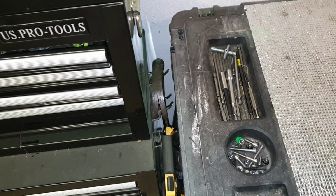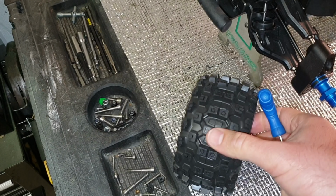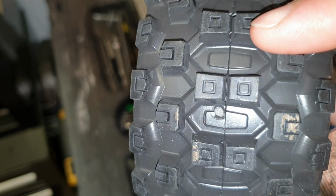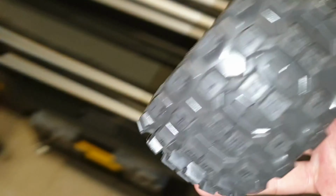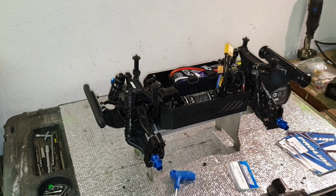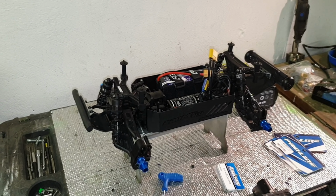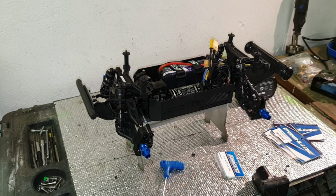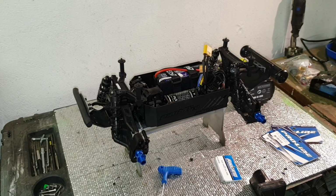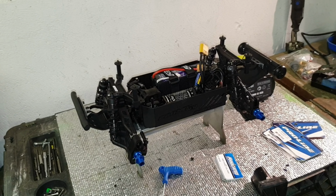With the wheels, I've used a leather punch. I sometimes use my, sorry, where is the hole? There it is. I've used a leather punch to do a neat hole on either side of the wheel. That is a vented wheel. That is what you need for driving anything in the winter months. Pretty much anywhere that's going to get wet. I have also done the same with my paddle tires, and I've sorted them out so they will be ready to go. I have some 2.8 Masher tires coming, and I have some 2.8 road tires, all from Proline, mounted, coming. So there should be a good suite of tires to use as well. I'll now stop this video, put the wheels and tires on, as well as the body that I've painted, so that you can see the end product.